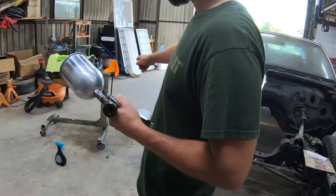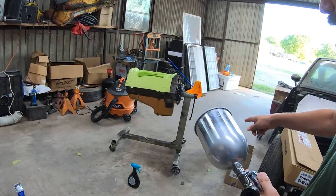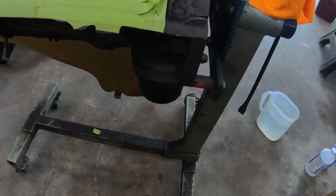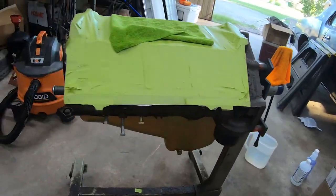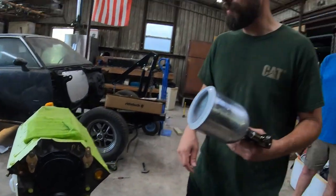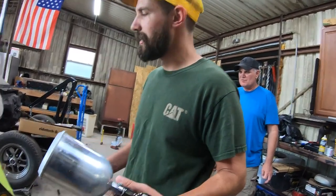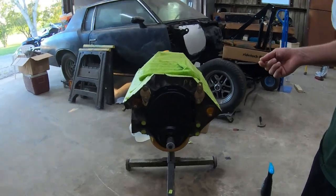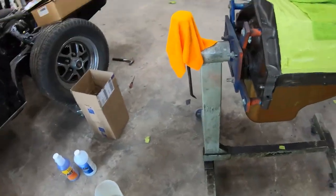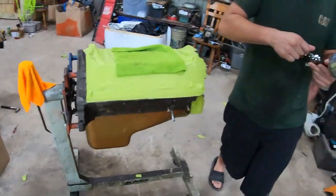Like, what are we gonna do? We just degreased the engine. Use some KBS. KBS is the bomb. Look how clean it is. So it's pretty clean. What we gotta do after this is apply zinc phosphate to it. Zinc phosphate is a rust inhibitor, and it etches, so it's a primer in a sense. Zinc phosphate's one of the best etching materials you can use. So we're not going cheap with that iron phosphate crap. Probably much too nice for this motor. Yeah, but I like nice stuff. I don't even paint my cars with a paint gun.